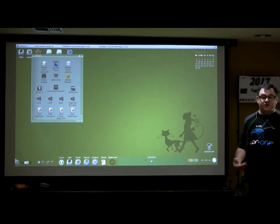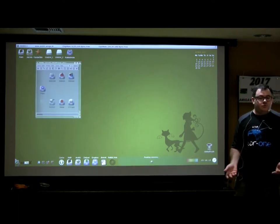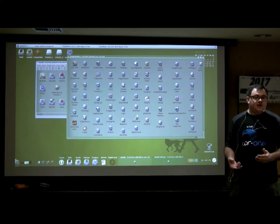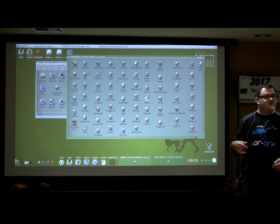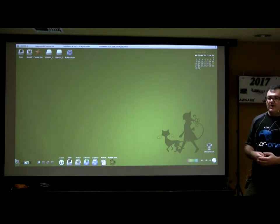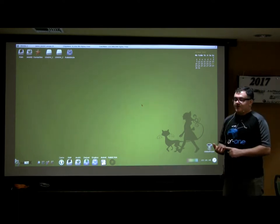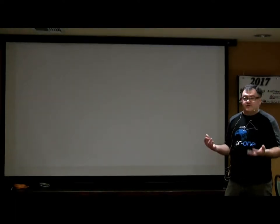The base SSD size is 256. I should have gone into this earlier, as I mentioned. But we're happy to accommodate people who would like a larger SSD. The i5 hardware configuration we're using today comes with a 500-plus gig SSD. There's some variance in exactly how much you get in SSD land with a 500, but they're all at least 512 gigs. This particular i3 machine has a USB-C port, which is kind of neat. It's got a couple of USB 3 ports and a full-size SD card slot in terms of hardware bells and whistles.